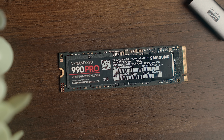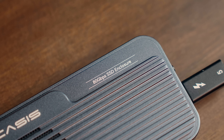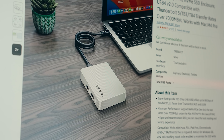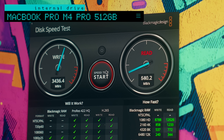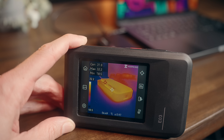More recently, I've moved on to the Samsung 990 Pro to go along with my Thunderbolt 5 enclosure, which I think at this point is the best drive available for Thunderbolt 5. The numbers on that thing are ridiculous — Thunderbolt 5 data transfer has the potential to go up to 80 gigabits per second, so double that of anything we've looked at here. On this Acasys TB501 enclosure that I've got here, with a JHL9480 chipset you're going to see in a lot of other portable Thunderbolt 5 solutions like the OWC Envoy Ultra, with the 990 Pro drive I get speeds that hover around 6000 megabytes per second read and write — even faster than the internal drives on the Pro-level Macs — and this also has a built-in fan that keeps everything cool.